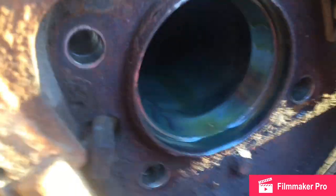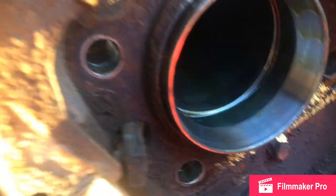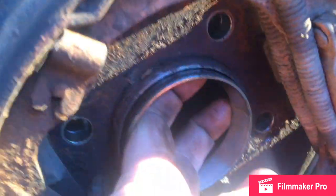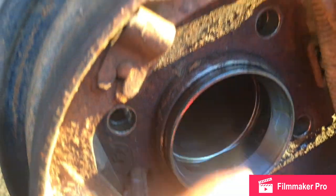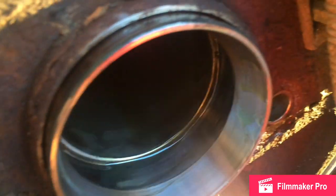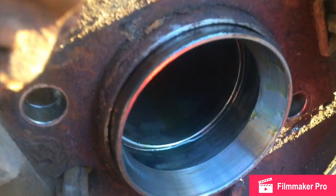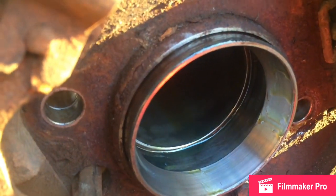Here's inside the axle tube. You want to make sure that you remove the bearing race. It is okay if it's hand tight — most of the time it is on JKs. You can just pull it out hand tight by working the corners and slowly pulling a little bit at a time. If it's frozen in there, you're going to want a bearing puller that can catch on the lip so you don't scratch the inside of your axle housing — you want that to be a nice smooth finish. If it is scratched when you're done, get some emery cloth and polish it up nice and smooth.